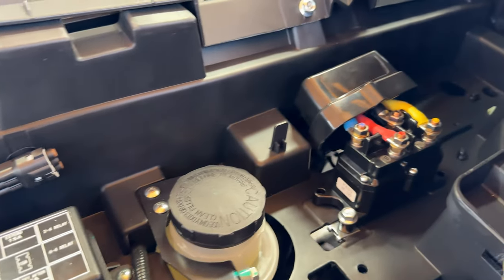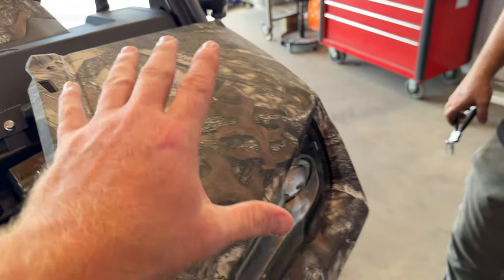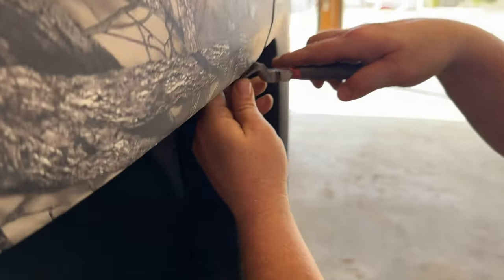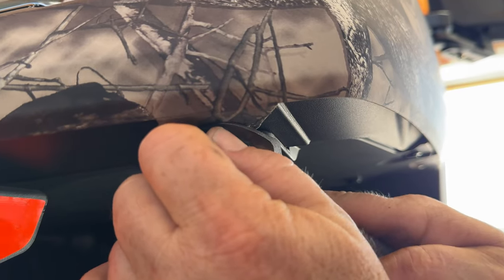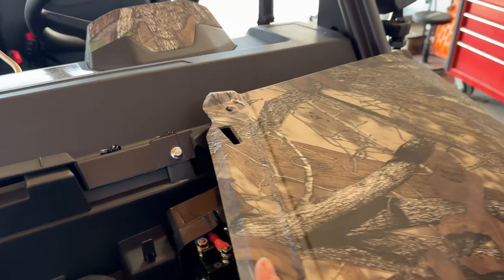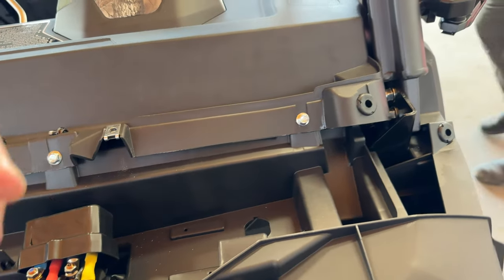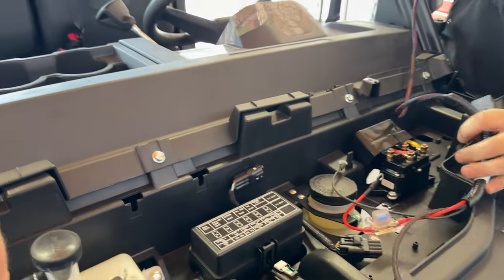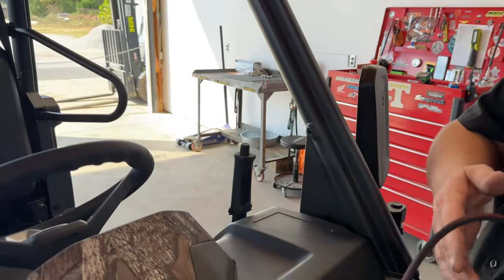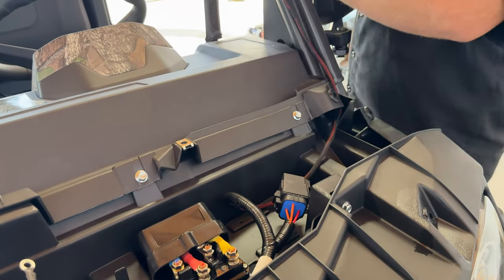Red and black there — we're going to run a keyed-on power to this wiring harness that's included. Just wanted to let you know on this step you can skip fully removing the panel, but Harmon definitely wants you to be able to see exactly the way he's doing it. He's going to take his little body panel clip remover — it doesn't take long to do this part. There are little rubber grommets here. Now you can easily see everything. We have our wiring harness that's included — you don't have to wrap it or anything; it's already come ready to go. We're going to route that up to the speaker and it's already got a plug on it. Makes this install very simple and you can definitely do it yourself.